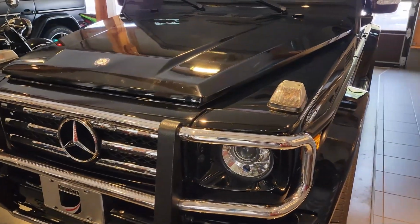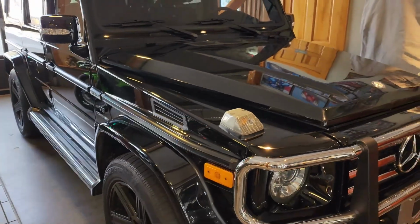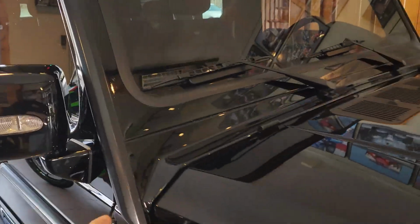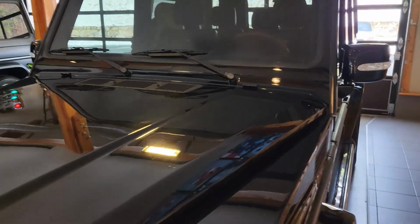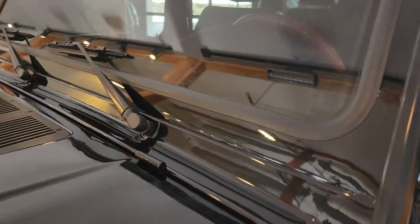And then we're also going to recommend paint protection film after the paint correction is done, and make sure, obviously, we're happy with that paint correction. And things like the windshield frame that were just freshly painted, the perfect time is right now to put paint protection film on there, and that will really prevent the rock chips and damage from happening again. Because of course, most of the corrosion that happens in these areas only starts because of rock chips.